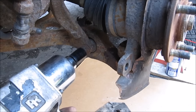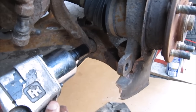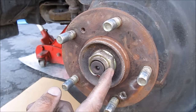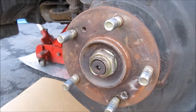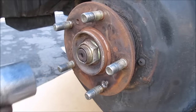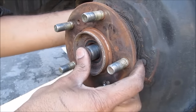To loosen the tension from the lower control arm I'm going to remove this 17mm bolt from the suspension fork and just tap that out. Next we need to remove the axle nut, but to do that we need to remove this dimple that holds it down — I'm just going to use a flat screwdriver and tap that with a hammer. Then I'm going to use an inch and a quarter socket to remove the axle nut. Now the axle should be free.